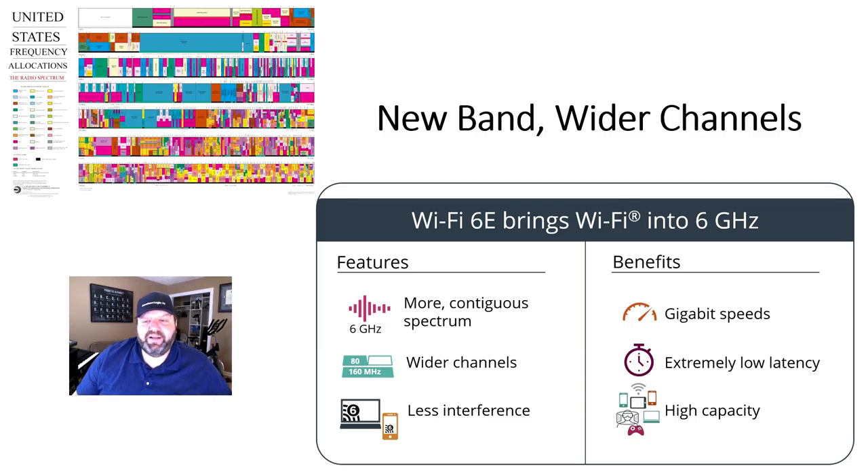One of the newest Wi-Fi 6, or Wi-Fi 6E, is actually utilizing new bands — the six gigahertz band. Traditionally, we've heard 2.4 GHz and then 5 GHz with our older Wi-Fi standards and dual-band routers. Now it's six GHz. So they're starting to expand into the bands, given the increasing device densities and networks around your neighbors or neighboring businesses. They're really trying to address those interference issues and use the spectrum better for all the devices that are popping up.